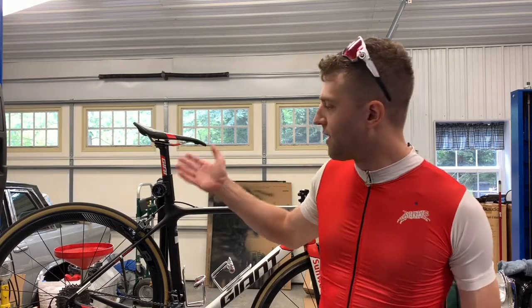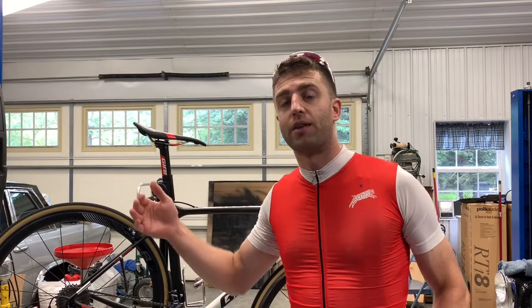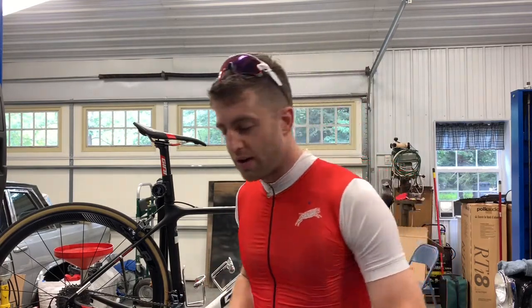So on this bike, 25C tires, I put in 90 PSI and I will change that based on the ride I'm gonna do, the distance I'm gonna ride, up or down 5 PSI. Some days I might go to 100. I don't really go below 90. My point being, you need to put air in your tires and know what pressure you're running before you go on your ride.